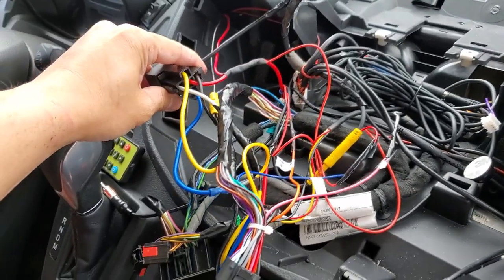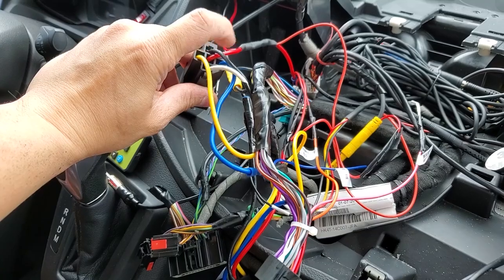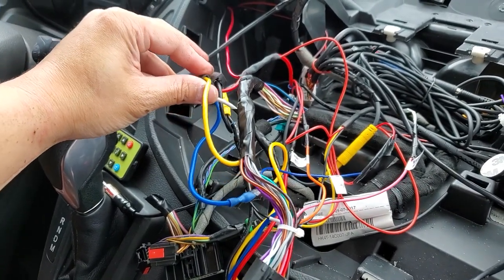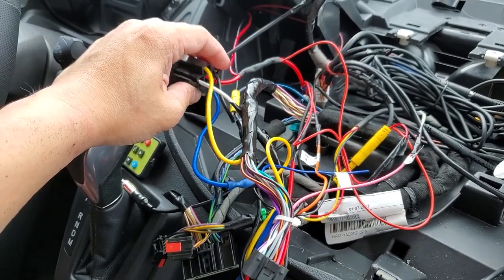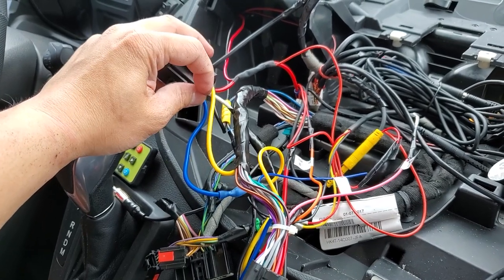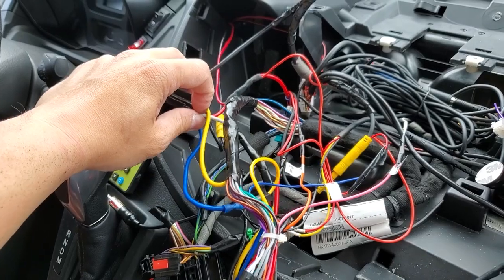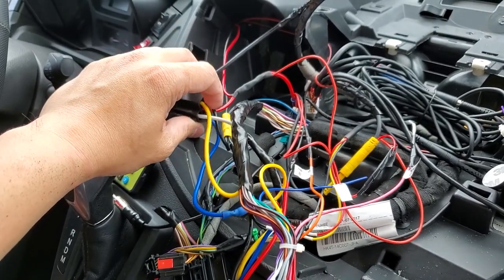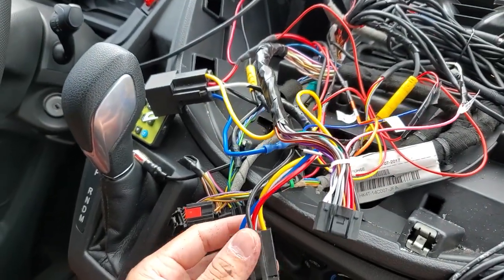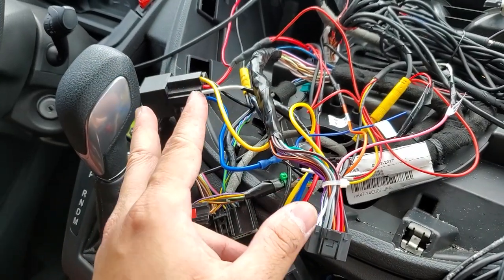And I have a five-way relay switch. You got your 87A from your house battery, 87, which is your vehicle's battery. 30 will go into the radio unit. The white and the black. The white is actually your accessory wires power. So that would turn on when your ignition switch is on. The black would be your ground. Need two relays. One for the accessories to run the power, and one is for the two power connections to go in.